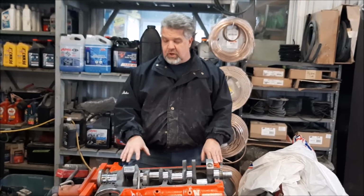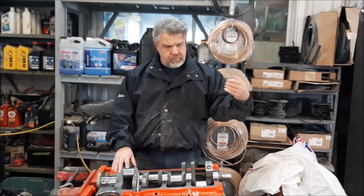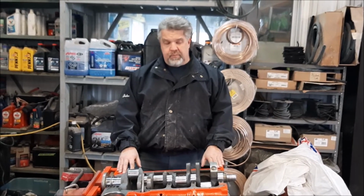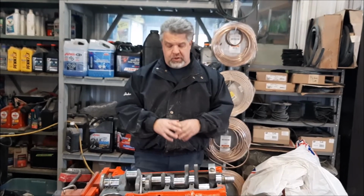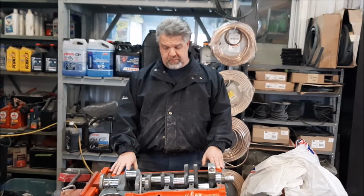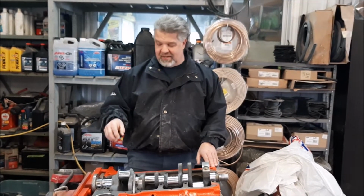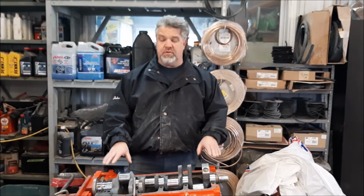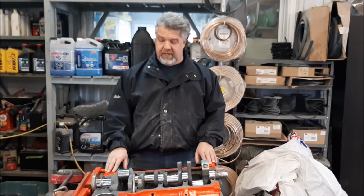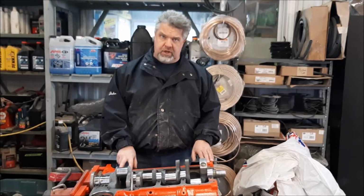So one of the things that got me nervous is when we completely disassembled the engine, after removing the pistons, we noticed that the pistons were 60 over. So that's the maximum that you can bore these holes on a 283 block. What I was nervous of is because this is the original block, all the numbers are confirmed, the date codes, the serial number, it is truly correct for this 58 Corvette. I really didn't want to have to go with a different engine block.